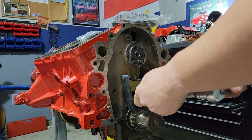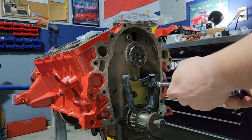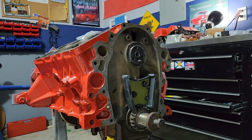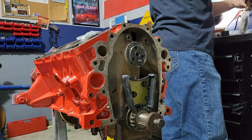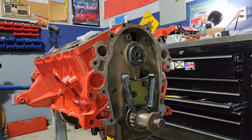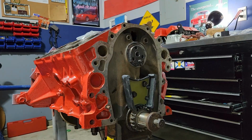So that's where you get these guys who talk about old engines that have 150,000 miles on them. You throw a couple extra degrees of timing in it, and it's fine. It'll read the wrong time, but it's correct, or it's better, and it runs better. It's just because there's slop in that chain, and they're not changing it. If you have that kind of slop in your chain, which this one, when I took it apart, wasn't that bad, and if you have a ton of slop, you are going to want to change that because you've probably worn it in pretty good.